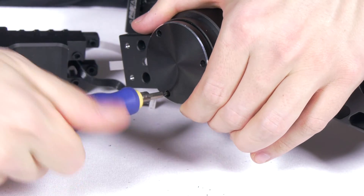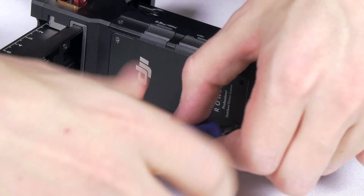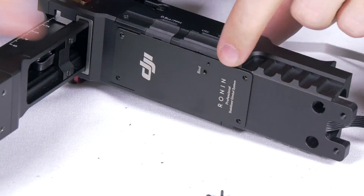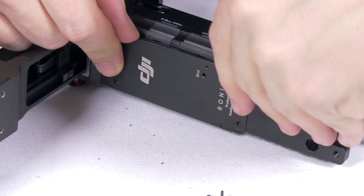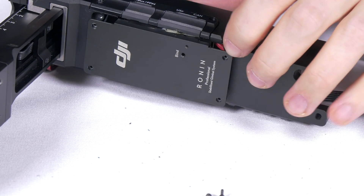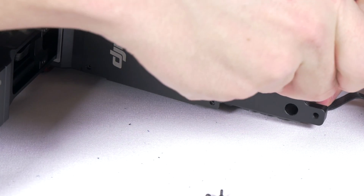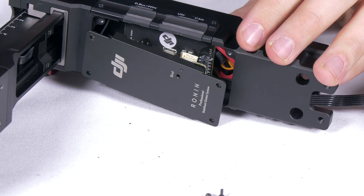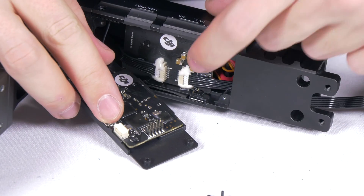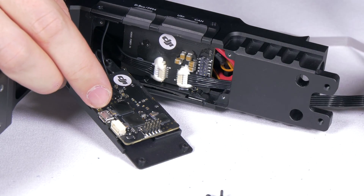Feed the cable through the extension and carefully put everything back in place with your new cable now plugged in. Now we need to get to the other end of the old cable and finish the connection. Get your 1.5 hex Allen key again to open up the main circuit board compartment at the back of the Ronin. Begin by removing the four screws holding the board in, then gently pry off the lid. Keep in mind that the board is attached by pins to a secondary board, so you must pull it out in a perpendicular manner to avoid bending these pins.